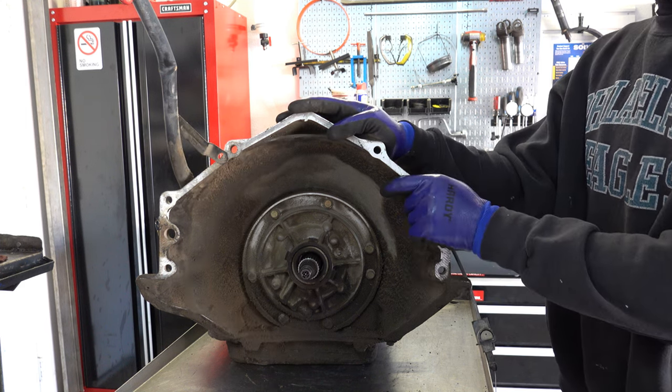One thing you really want to pay attention to with these pumps is this bushing right here, and this applies to the 4L60E also. If this bushing gets overly worn, or there's contact between it and the base of the input drum, the shaft rather, then you'll get blow by through that location, and that will cause all kinds of erratic shifting issues. In the case of the 4L60E, it may generate code P1870, which in most cases is the valve body torque converter clutch regulator valve.